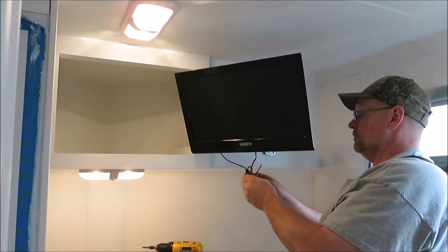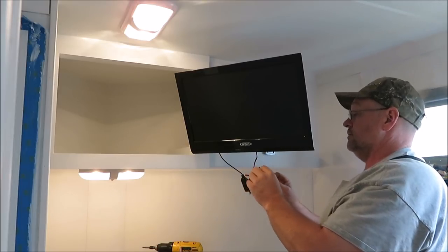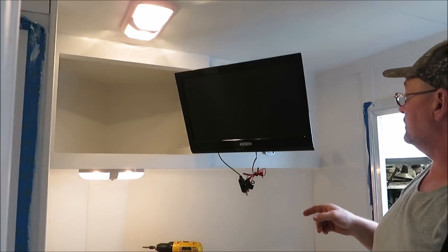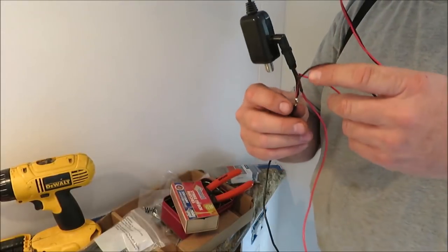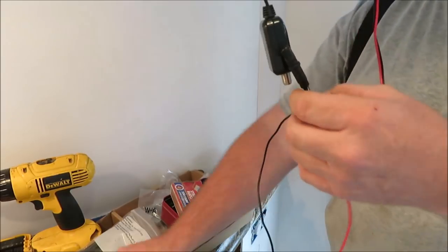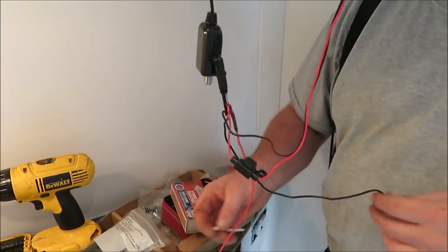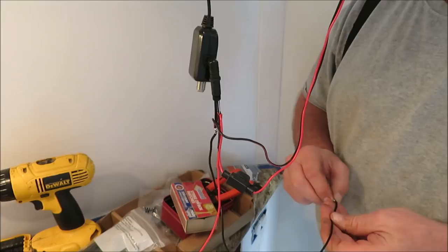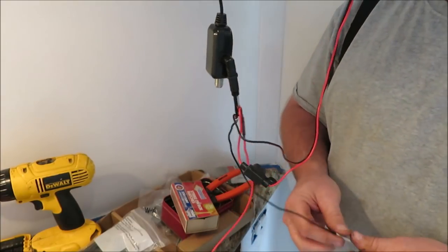Now I'm going to get these wires all unhooked here and get a hole through the wall for the power wire and the antenna - that's the next step. Now all the wires, I try to make sure I solder them first. I've soldered these wires and now we're just going to put some shrink wrap on them and try to seal them up good, and we'll put some tape on them too, just to make sure we're okay with no shorts anywhere.